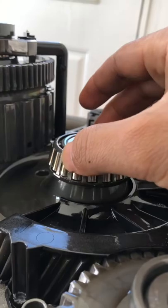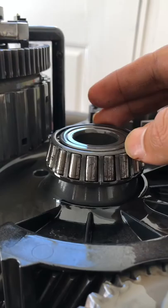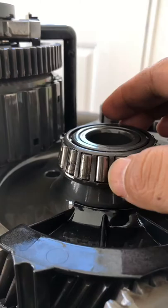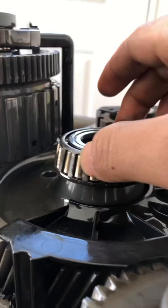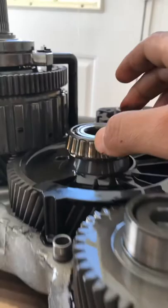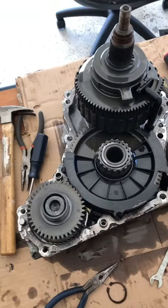When you open it you're going to start finding bearings everywhere. My particular issue was this one — check out how bad this is. You can tell right here that this damaged bearing was causing my issue. This thing doesn't even have the metal piece in it — it's got a hole. So yeah, this bearing was causing the noise. Anyway, hopefully this video helps you know how to open the transfer case for this particular model. This came out of a 2013 535 XI — good luck guys.